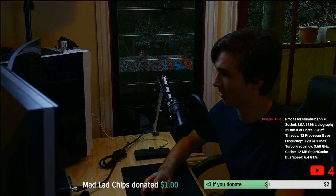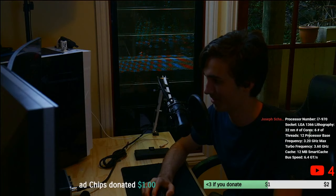the i7-970, no, that's terrible, don't buy that for $70. That's a pretty bad CPU. For that same price, you can get some old Xeons. I actually have a video on the Xeons that you can get on that platform. Because if it's an LGA 1366, it's pretty terrible. I would not go for that. X58, while it was a really good platform, it's not the best to go for today because the motherboards are super expensive.